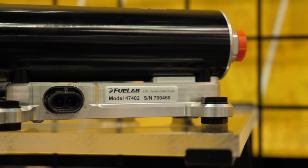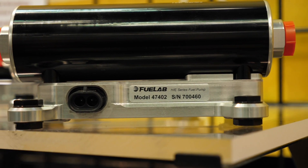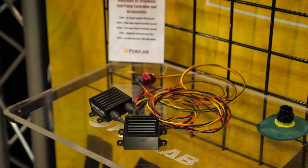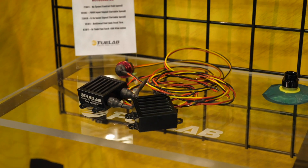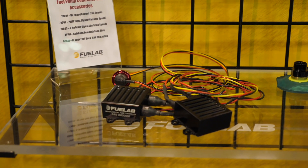With a brushless pump controller, we can actually control the fuel pump speed and hence the amount of fuel flow out of the pump. There are a variety of options — some pumps will allow a pulse width modulated output from the ECU to vary the speed of the pump. In the case of the Fuel Lab controller we're looking at here, this can reduce the flow of the pump down to only 20% of its maximum. By ramping up that pulse width modulated output, we can then increase the pump flow back up to its maximum as the RPM and load increases and the fuel demands also increase.